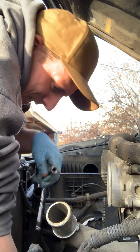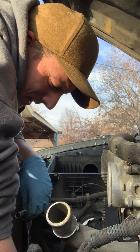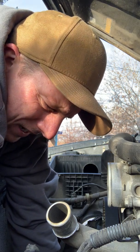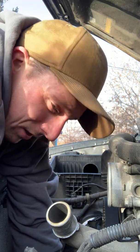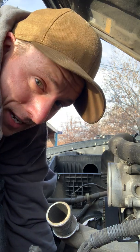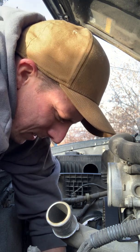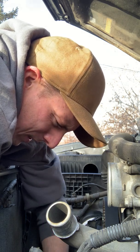For plastic covers and valve covers and things like that, when I'm tightening them down I put in all the bolts finger tight first — just get them all threaded before I start tightening anything down. That ensures the cover is lined up properly. It's a real pain if you put in one bolt, tighten it down, and then the other bolt doesn't line up. I like them all to be uniformly tightened as you put things together.